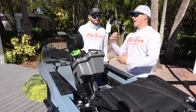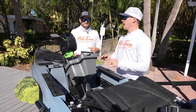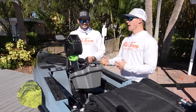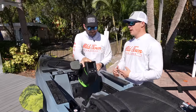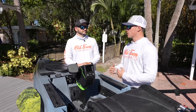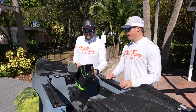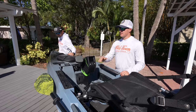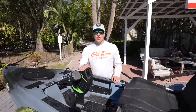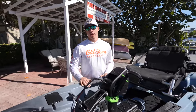Let's say you're going fast and you want to stop the motor. You can also pedal backwards and that will disengage the motor and start it back at zero, then you can get going again. It still has forward and reverse ability, and reverse will stop the motor — it will also stop cruise control. Anything you're currently doing, you'll be able to pedal backwards and then just start over again. What happens if you flip? Is that waterproof? Yes, it is IP67, so it is submergible — waterproof — so you're able to not worry about dropping this in the drink and it not working after the fact.